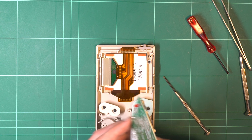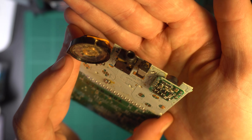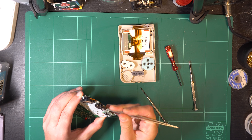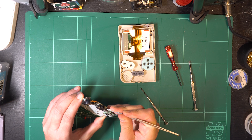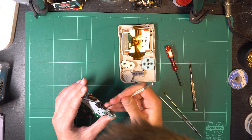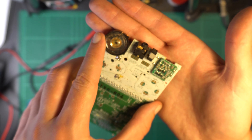After pulling the main circuit board out I noticed that something seemed to be jammed in the power adapter socket. It's as if a plug had been ripped off at a 90-degree angle and the innards had remained within. I ended up using a small flat-headed screwdriver and just carved it out. The pin was bent out of position so I edged that back into shape using the flat-headed screwdriver.